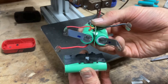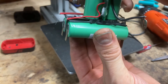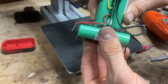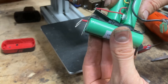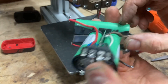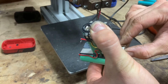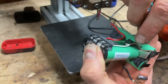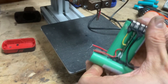I'm going to put a couple more tabs on here and these will wrap around those contacts we were just working on. Of course this is going to be too long so we'll shorten them, and we'll do that to each side. This green PC board fits into this slot here — make sure you have that nestled in. If it doesn't nest well, it could be because either this red wire or the brown wire on the back side is getting in the way. Just wiggle everything a little bit and it should pop down in there. Make sure your tabs are aligned. At this point we can secure this brown wire and the red one to anchor them a little more.